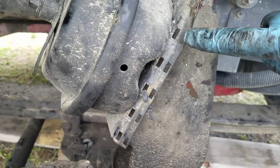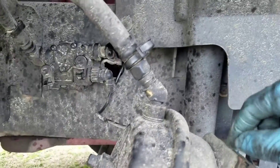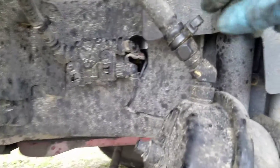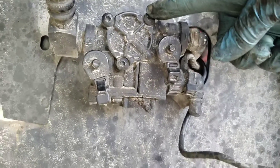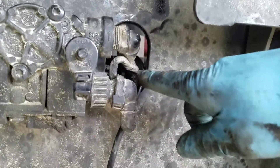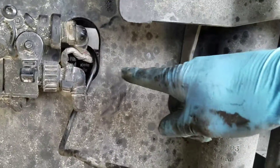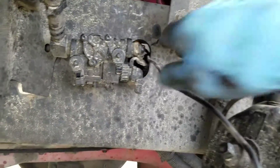It's wrapped here, zip-tied here, then it comes up this metal flange and it's zip-tied. Then it jumps from here over to this airline and it's got little keepers all the way down it, jumping off to this junction box of the airline. It comes through these zip ties, then goes in this hole in the frame and then goes on the inside of the frame all along till about right here, and it's got a plug. I've already got all the zip ties loose inside there — it's just a simple two-prong plug.